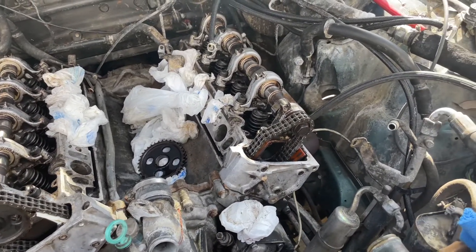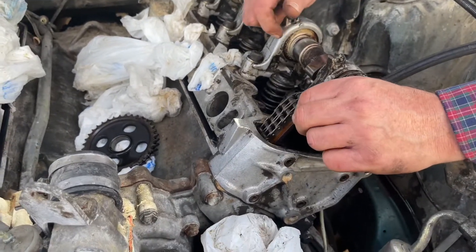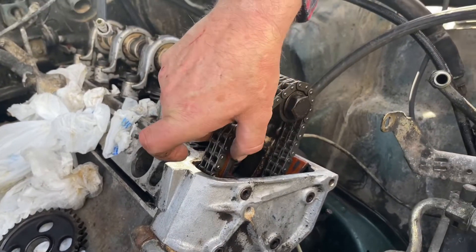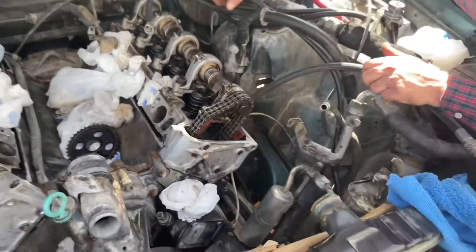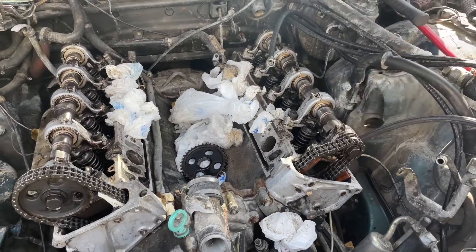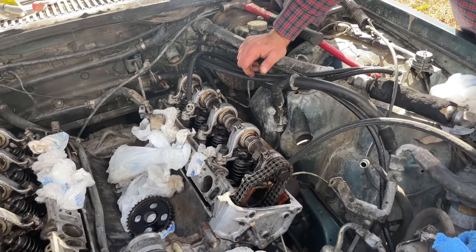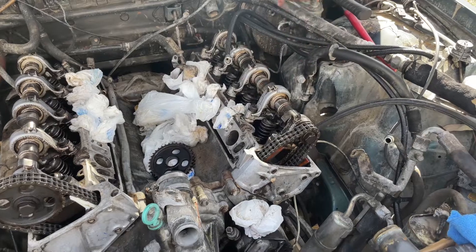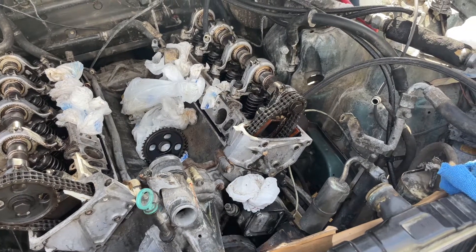What we're going to do about this, I have to think about. The task right now is to take out the broken guide rails — we have new ones, and one is already installed on this side. I'll be showing you how to take the broken one out, to see where the other parts are and if anything else is missing. Then we'll rotate the engine through and lower pistons one and five down to the 180 degree mark, put the bore scope in, and see what the top of the pistons on each side looks like.